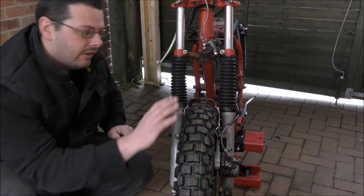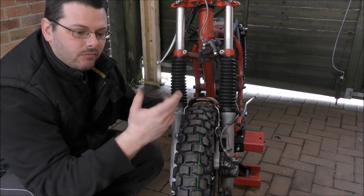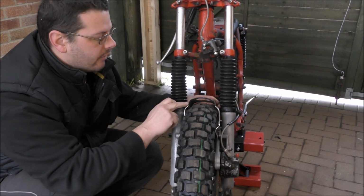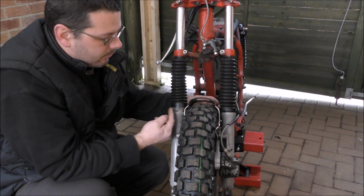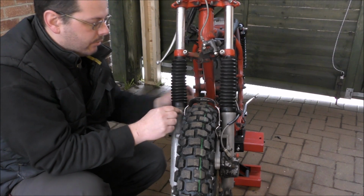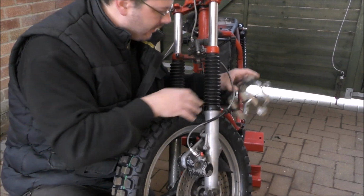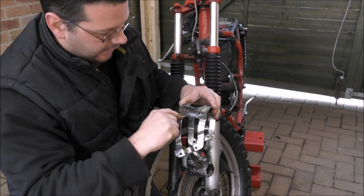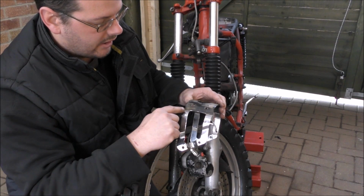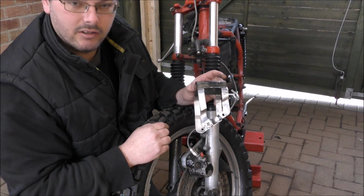Now, with the whole lengthening of this thing, we're a little unsure as to whether or not this bracket provides any torsional strength, or whatever you want to call it, to stop the forks twisting. So because we're going to be cutting the top off of this and straightening these pieces out and moving it out a little bit, when we add the piece of metal in, we're going to add it across the entire thing, so just a bridge. Hang on, if I can pull this out, I'll show you. Easier said than done. So we're cutting off across here and here. So technically we're removing this top piece. So if we add in the piece of metal across the entire piece, and then pop this back on the top like a little hat, that'll maintain the strength of it, I hope.